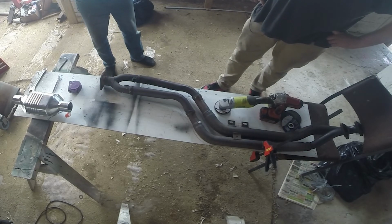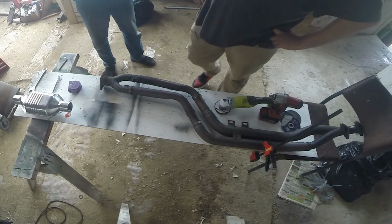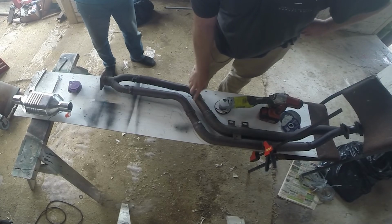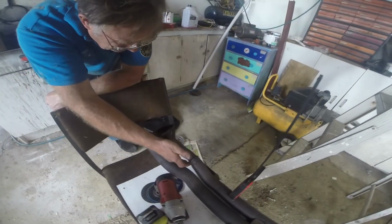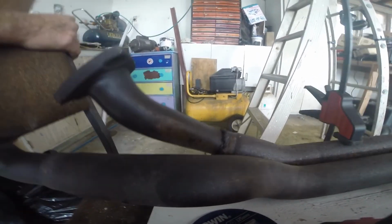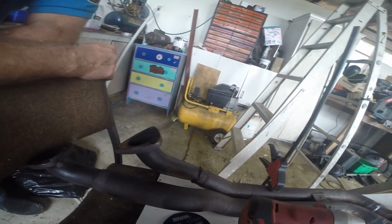What was that? But there's just something not quite right. More likely, there was an extra piece here that straightened it out, and straightened it out here, but this one was slightly longer. Because then it would match up here, and then the cat would go here. There's even a bit of wire sticking out the side of it where they're welding it. So that's definitely been messed around with. And it's blowing here, up around the side, probably because it's not in the correct position.